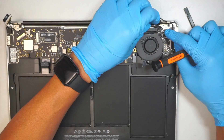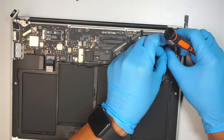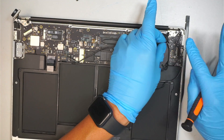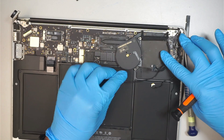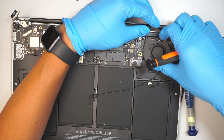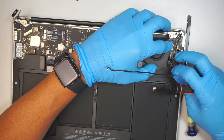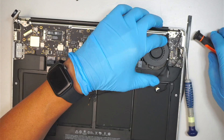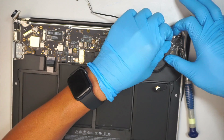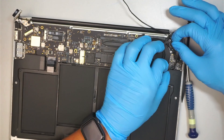The next step: align and open up the CPU fan, then get the cable tucked underneath — go back in and route it around, then have the CPU fan go back on top above the rubber and tuck it in. I was briefly using the wrong cable — that was the WiFi cable. This is the correct cable for the screen.